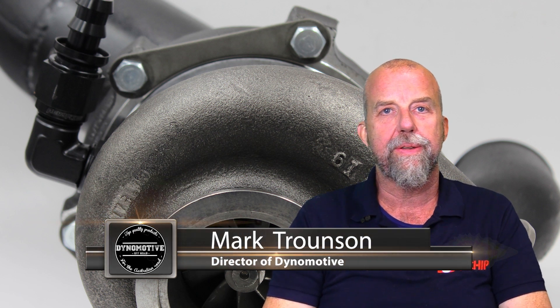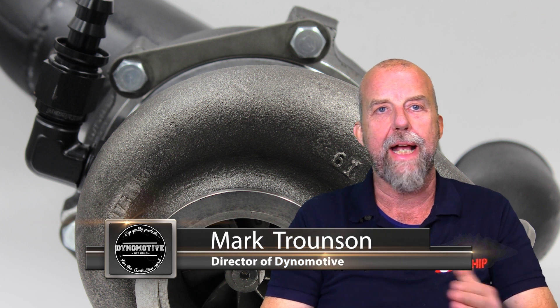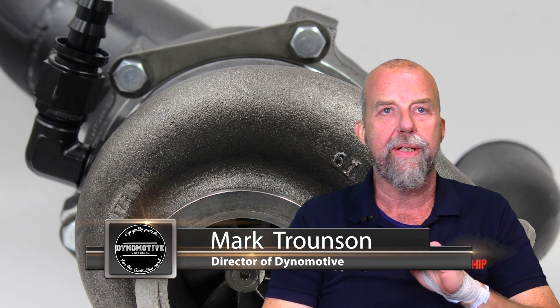With anything like this, we always start at the maximum number that we're going to see — the maximum boost number and the top end of where that's going to be. We get the fueling right there for the diesel, and we're doing injection timing as well. We get those two tables, which we can live tune, right at the maximum boost number we want to see, making sure everything's happy at the maximum, and then we work our way back down to blend to the minimums — minimum fuel trims, cruise fueling, and all that sort of stuff.